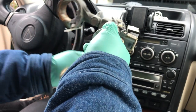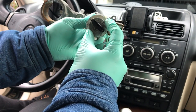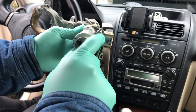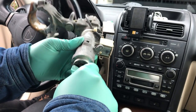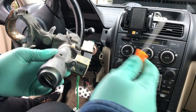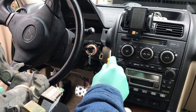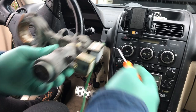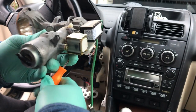Once the sensor ring is removed, you have access to just the key cylinder. One important thing: you're not going to be able to remove the key cylinder if you don't have a key, so make sure you have a key. The tools you need to remove the cylinder are pretty much just a flathead screwdriver, a Phillips screwdriver, and a pick.